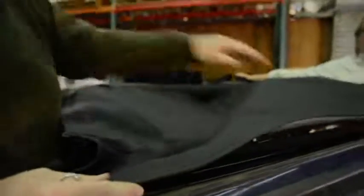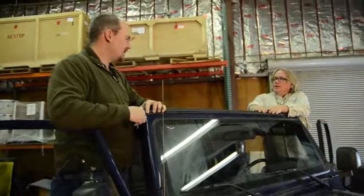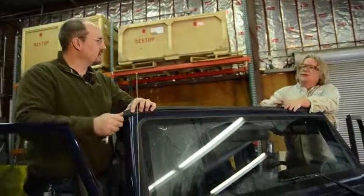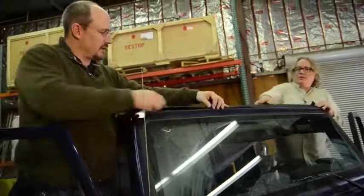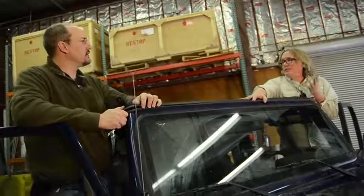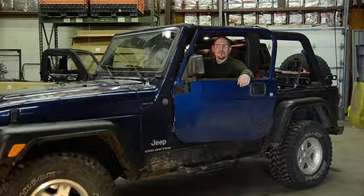Then fold it and tuck it around the corner into the plastic end cap — that'll keep it securely installed. Next, pull it off to the back so you can get the straps started to secure it in the channel. This is a frustrating moment in installing a bikini top on a TJ because it pops loose while you're trying to tighten the straps. Your best option here may be a piece of tape to help it stay in the middle, or have another set of hands in the back. Like with a lot of soft tops, that's an initial install issue — once this plastic softens and forms to the channel, it should be a little easier the next time. It'll stay secure when you get the straps on so it doesn't come off when you're driving at 80 miles an hour on the freeway. Once you've got the header clamped down, the retainer in the channel, and the straps all cinched tight, you're ready to take it off-road or out on the trail.